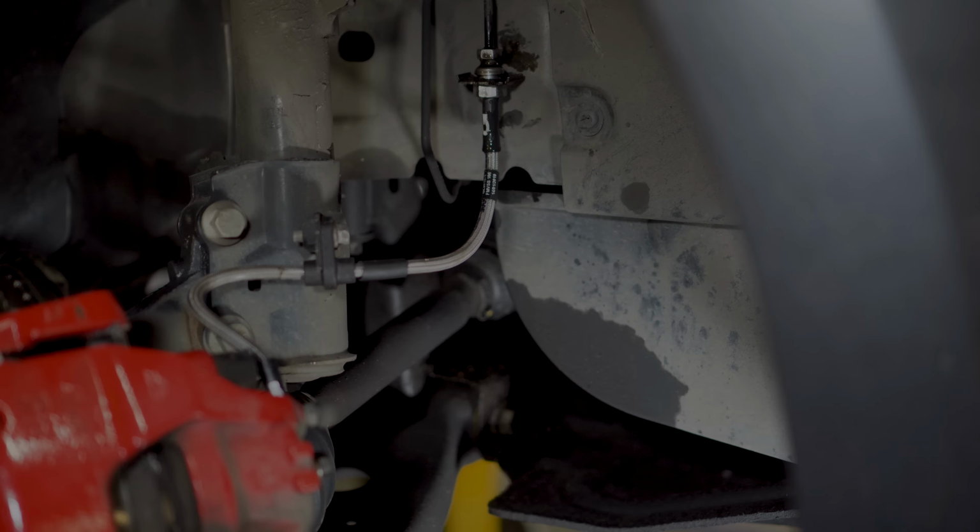You can now place your disc onto the hub, but remember to clean it with brake cleaner beforehand. The caliper brackets will need a rub down with a wire brush before we apply the high temperature grease, as we did with the brakes on the front. The caliper bracket can then be returned to the car.